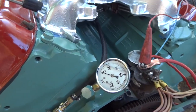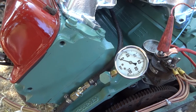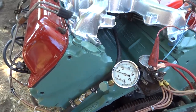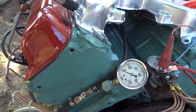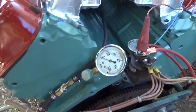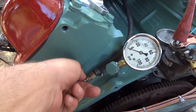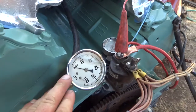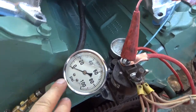We need to be able to close the fuel valve so it doesn't drip, because it leaks through the injection pump if the pressure is continuous — all these pumps have some amount of blow-by, and that's just normal. Over time that would empty out the bottle pretty fast, so we have to be able to close the fuel line.